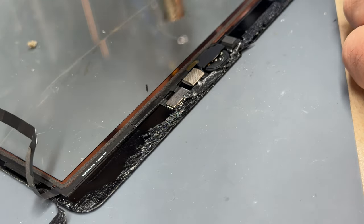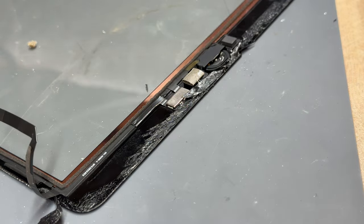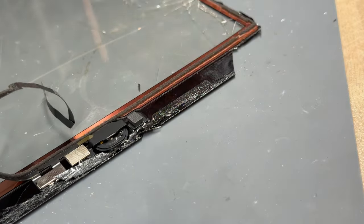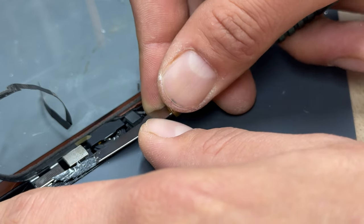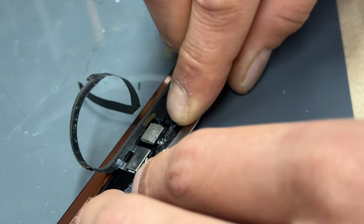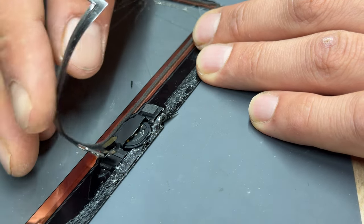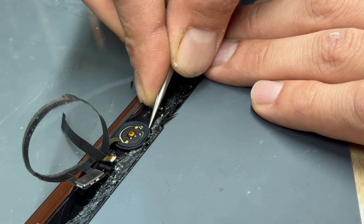Once the adhesive is softened, carefully pull up on the cable to release it from the back of the digitizer. Leave it curled back like that, and then use the number 17 exacto blade to get underneath the brackets — releasing one side and then the small bit of flex cable that sticks to the back of the glass. Go very carefully, make sure you're underneath it, and then pry it upwards. That's releasing it — carry on lifting, peel off the last bit of flex cable, and that should mean we can now release the bracket.